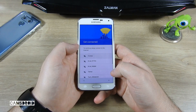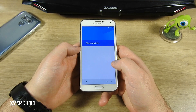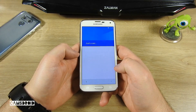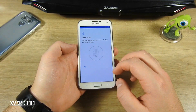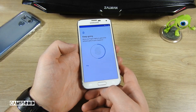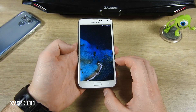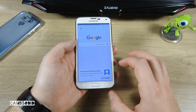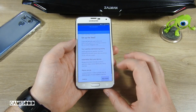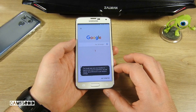Select your language, choose whether to restore apps or set the phone up as a new device, connect to Wi-Fi, log in to your Google account, set up fingerprint unlock, and finally select your launcher. I like the Pixel launcher quite a lot. I haven't played with this ROM much, but everything I've tested has worked, so I feel it's quite a stable option if you wish to run Nougat on your Galaxy S5.